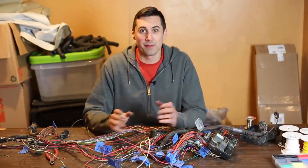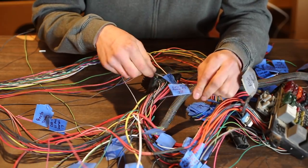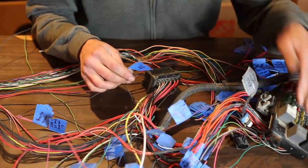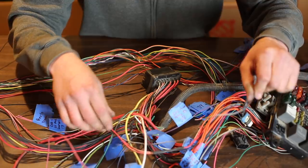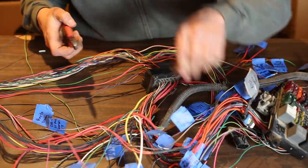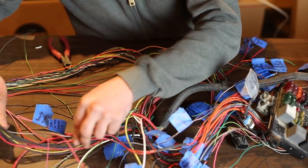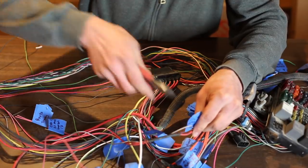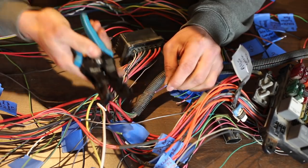I have the harnesses back in the house and it is time to start soldering these connections together. I'm not going to film soldering all of them, but I am going to film one — this one is the control wire for the injection pump relay. This wire comes from the PCM and this wire goes to the relay box. I labeled both of them number 38 to show that these get connected together. The wires coming from the Dodge wiring harness are plenty long enough — I have more than enough extra wire so I don't need any additional length to connect the two.